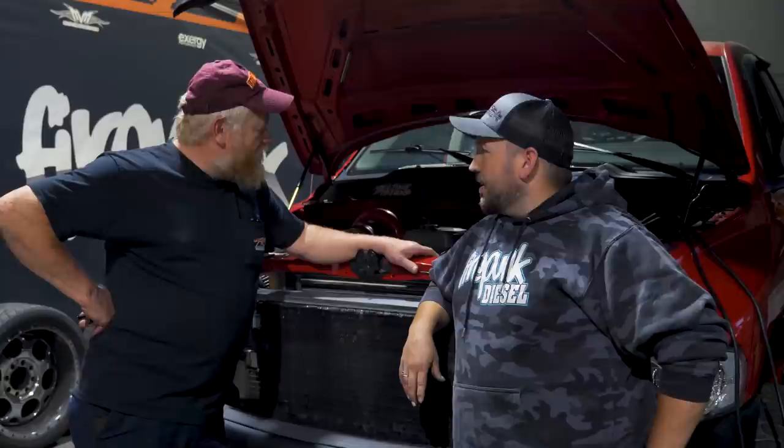Trent definitely did a good job on the engine. Tidied up some wiring and some other stuff, so everything looks good. We really fought through the limiters on Smarty Touch. Yes. And finally we just switched it over to HP Tuners. There was some limiter that I don't have access to in Smarty Touch that it was hitting a hard wall, and we didn't want to waste all day. We got close to it. At 3100 RPM, it would just shut off. Right. And now it's, 4500 we're going to easily. We got full fuel to 5000. We ran it to 4500.